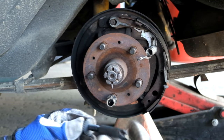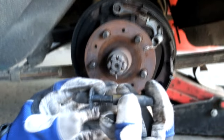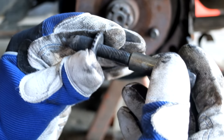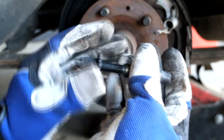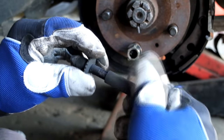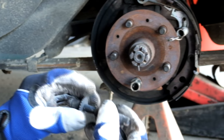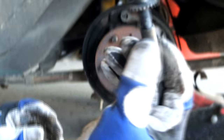For those who have never seen inside a drum brake, this is the adjuster. As your shoes wear out, there's a little tab back here that catches on these teeth and it adjusts the shoes out as they wear, so that you never lose braking. Any drum brake does this. When you put new shoes on, you screw it in, and then screw it out as far as you can until the drum just barely fits over the shoes, and then it'll adjust itself from there.